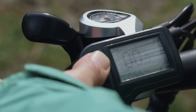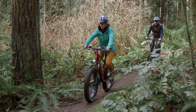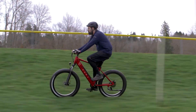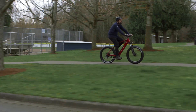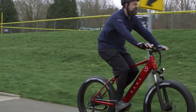Start riding and get a feel for the power of the motor. When you're comfortable, press the plus button to increase your level of pedal assist — Gen 3 electric bikes are powerful, so ease into it. Make sure you test out your brakes, as electric bikes are heavier than traditional bikes and require more stopping power. The disc brakes are very powerful, so get a feel for how they'll slow you down. Always use both the front and rear brakes together for the safest possible stop. Check out your shifter, working through the available gears. If you plan on using pedal assist or the throttle, we suggest using gears six or maybe seven. Once you're comfortable with pedal assist and how the brakes react at different speeds, you can try out the throttle. Apply a small amount of pressure to the throttle using your thumb, and as you get comfortable, experiment with more power. The throttle and pedal assist are independent, but the riding experience is seamless — feel free to use either or both at the same time.